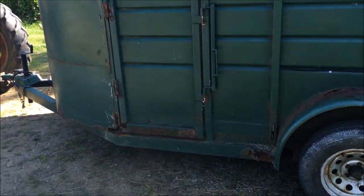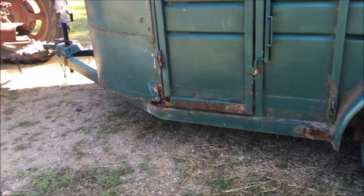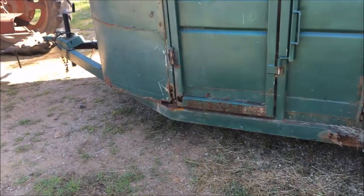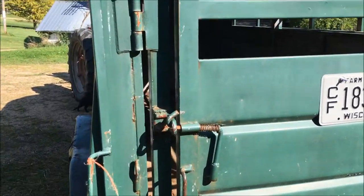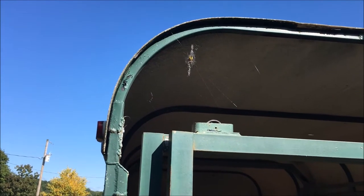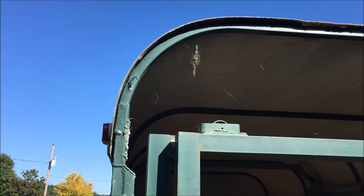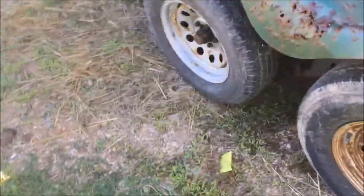I have been doing a little other work — basically the frame of the trailer is good, the top of the trailer is good. The problem is where the top meets the frame: the lighter box steel has gotten kind of rusty right there. It had broke loose and I welded a piece of heavy angle iron out there. I also notice there's a pretty impressive-looking spider up there — I think I'll get rid of him before I do a lot of work on here.